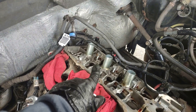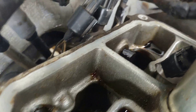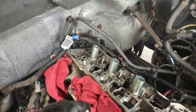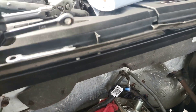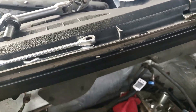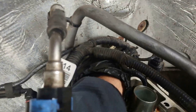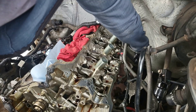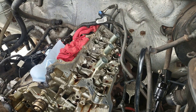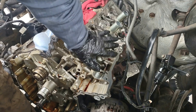Cylinder head number two on the driver's side — the camshaft position sensors are right there and they're kind of painted onto the neck. To remove the bolt I used an 8mm ratchet wrench and barely got it with a small ratchet. Push it from here to release. The head bolts are 15mm. The exhaust manifold studs were cut since they were all rusted.